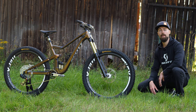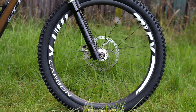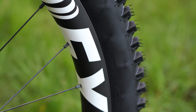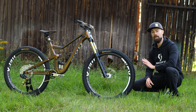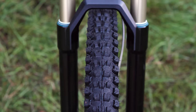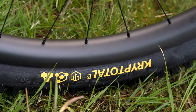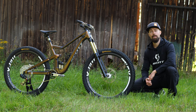The Onyx hubs have been laced up by German wheel specialist Transportteknik Müller, who also provide the rims — their own in-house brand, the MFX Carbon. These are just massive in real life; the wall thickness is unbelievable, intended for enduro and downhill use. For tires I chose the new Continental Kryptotal front and rear — the tread pattern looks really promising and I know from experience that the rubber compound is really good and super grippy. This model comes in at about 1300 grams per tire in 2.4 inch width, which is quite a lot. The tires are set up tubeless with Syncros Eco Sealant, without inserts for now, though I have some Cushcore just in case.